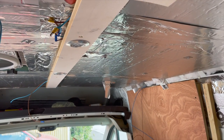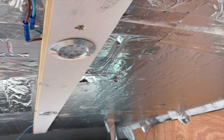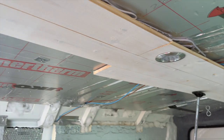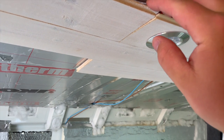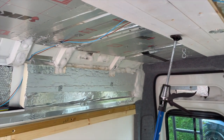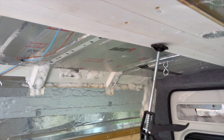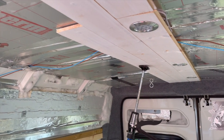Here's the progress on the ceiling — those are the cables ready to connect into the main feed for the lights. I've countersunk all the holes so they can be filled over, and given the wood a coat of primer to seal it off — done on both sides. You can see how we're getting along with this join here. I've tucked all the cables up behind and I'm hoping it'll pull together as we put another piece in. I'm fairly happy with how it's started — it's fixing up well and staying in place. I'm using a plasterboard prop to close up the gaps while working on my own, just to get the support so I can concentrate on keeping everything straight and level.